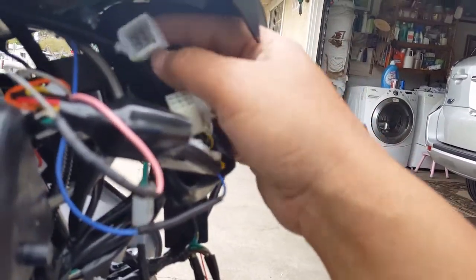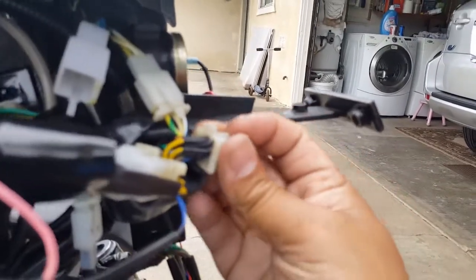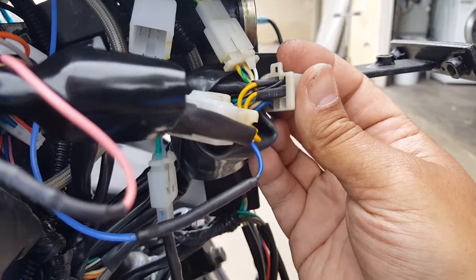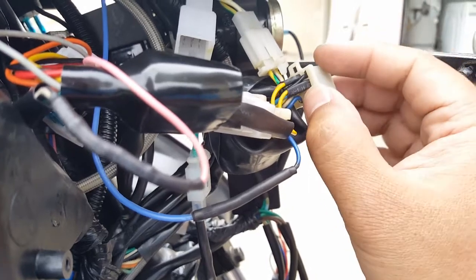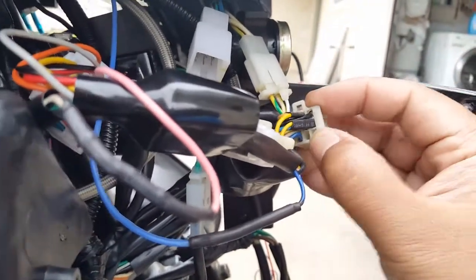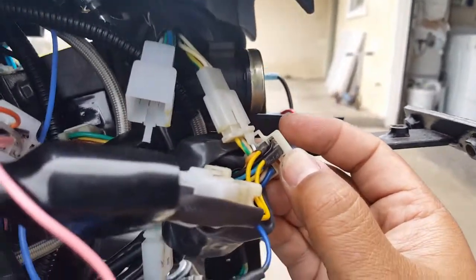I know this is a new wire harness here because it's a new gauge cluster. So it has to be from our end that we did something here, right? That's causing the intermittent issue. If that's the case, it should be a quick fix. I think it is. We can probably take this guy off and use our T-clamp. Look at that black wire. Look how funky it is. You guys see it?